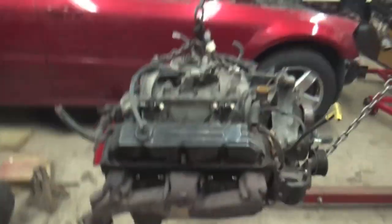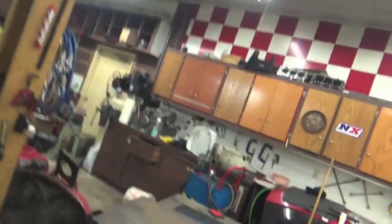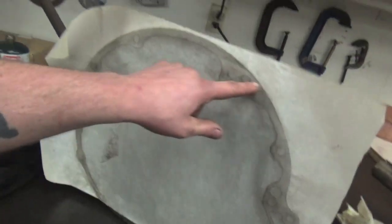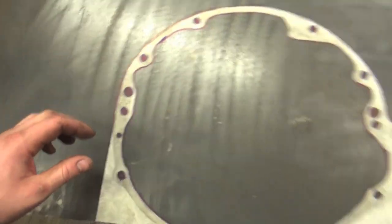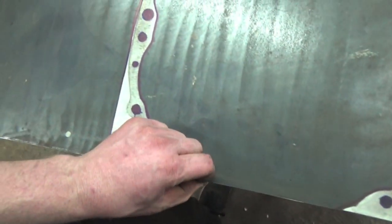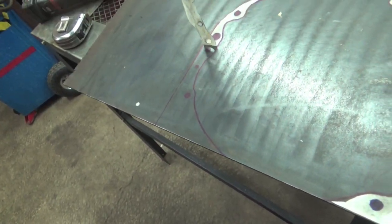Now that we have a rolling chassis, we're gonna get the motor positioned exactly where we want to put it and start making the back motor plate slash starter holder, and we'll start making the front motor mounts. We've already traced out how the motor plate's gonna be on a 904 transmission, so this shows us exactly where the starter's gonna go and how it's gonna bolt up. We'll dimension it a bit with some measuring to fit in between the frame rails. So we got the motor plate all cut out and marked on this quarter inch piece of plate — now we're gonna actually start plasma cutting this out and drilling all our holes to mount to the back of our engine.